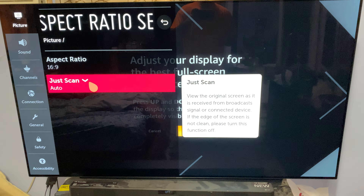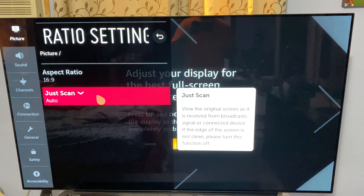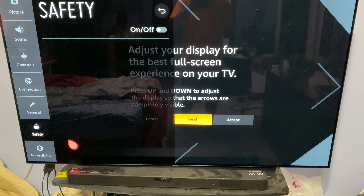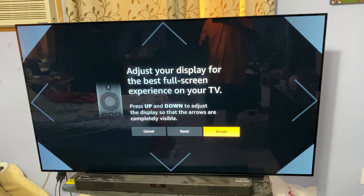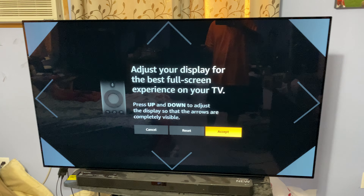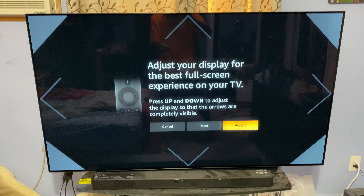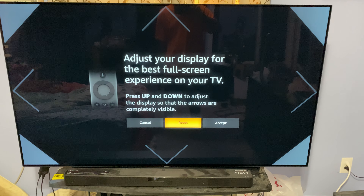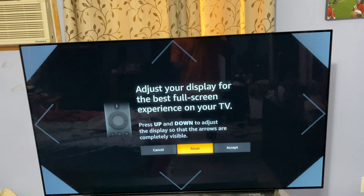And this drove me crazy because I had this on the B8. I realized I was playing with all the settings I could. You just have to turn JustScan to on. This device, the Fire Stick, for whatever reason the way it displays content, you have to go to JustScan to get the calibration properly. And you don't even have to move the arrows — you can keep it on the default. You just have to turn JustScan to on, and boom, everything fits in now.